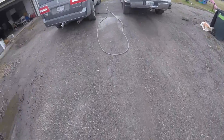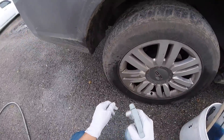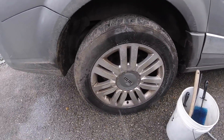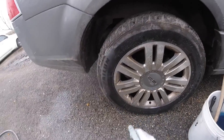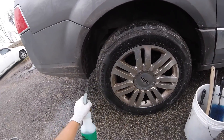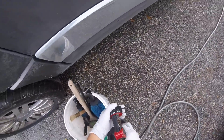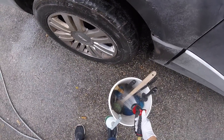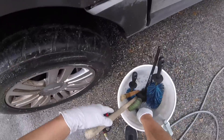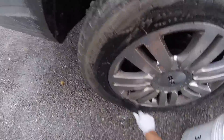Because the vehicle is really dirty, I will take the entire bucket. Usually if it's not that dirty, I'll just take one or two brushes. But since this one was really dirty, I'm actually going to fill up the bucket with water to give myself a better setup for cleaning these really dirty wheels and tires. The product here is Super Clean diluted 10 to 1. On this particular wheel I'm using a trigger sprayer, but when I move on to the next three wheels, I'm using a pump sprayer, which made life a bit easier. I can continually rinse off the brushes while they're in the bucket.